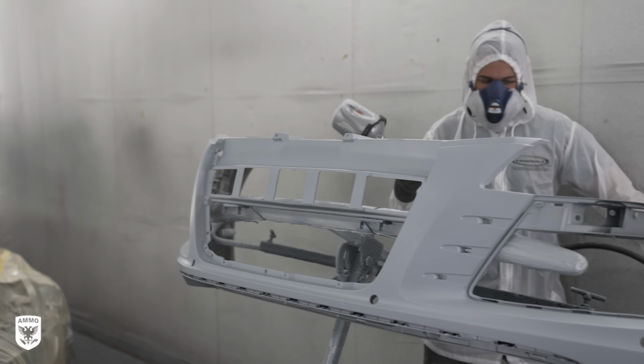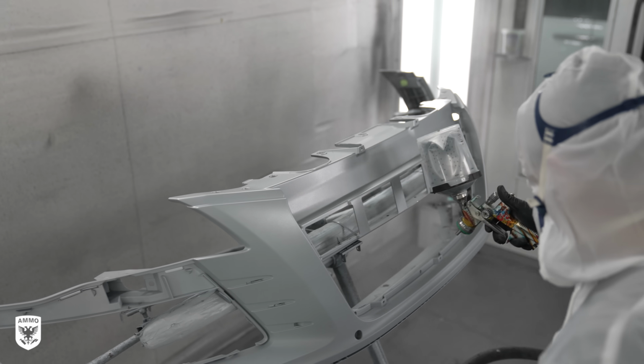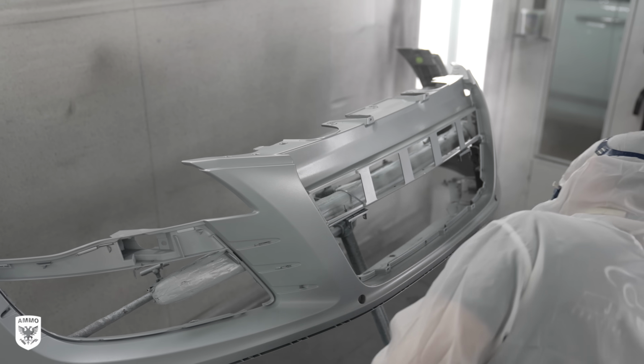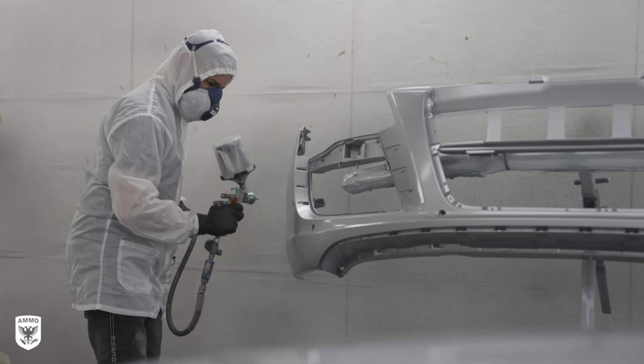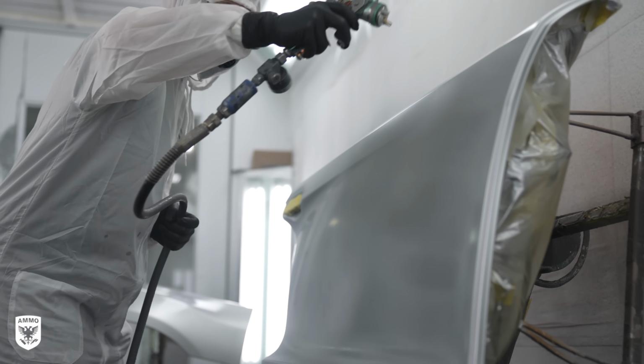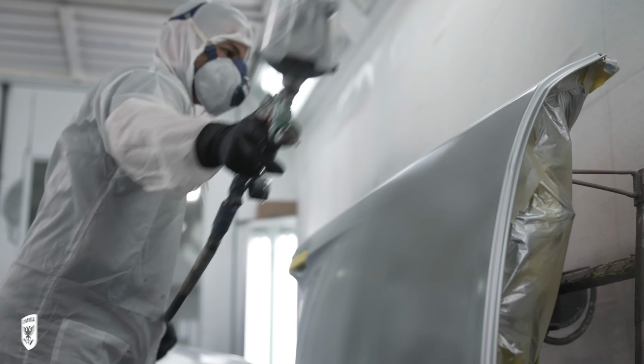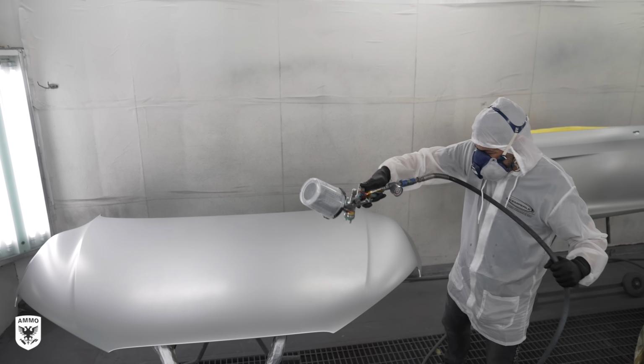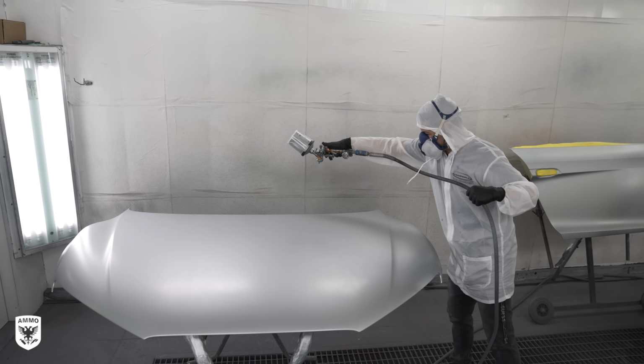As the base coat process begins, Francesco will apply 2.5 coats of silver at about a 70% overlap with 10 minutes of flash time in between each coat. The last coat, being what they call an effective coat, is sprayed at lower pressure and further away. By not following this precise procedure, it actually results in blotchy, or what they technically call mottled metallic.